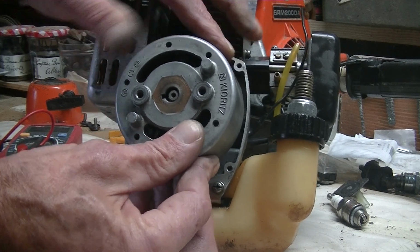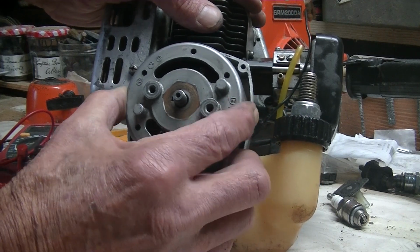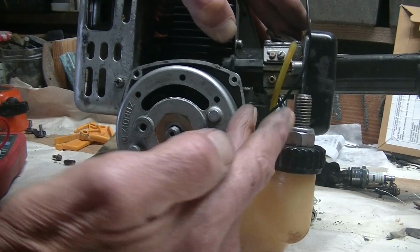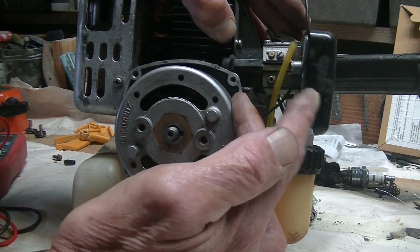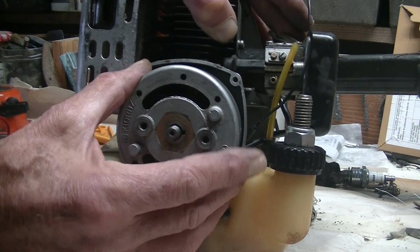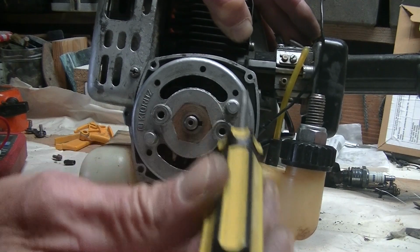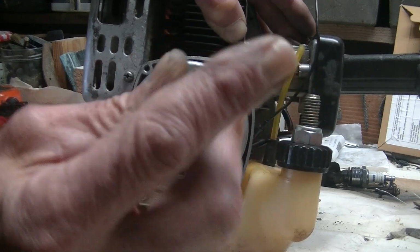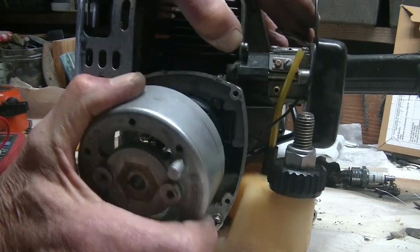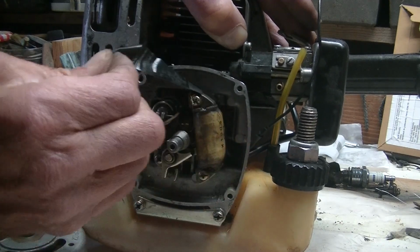And now I'm going to put the cover back on again, with the magnets on this side, away from the coil, and then I'm going to turn it until the magnets are in line with the coil. And now the two magnets, after I've turned it, are on this side, and they have drawn the coil into the correct position with the tape in between. And now I'm just going to tighten it up, pull it away from the magnets and then take the tape off.